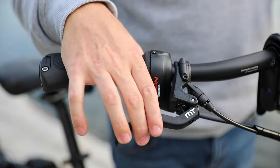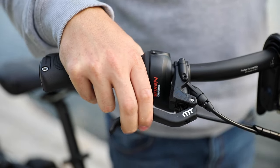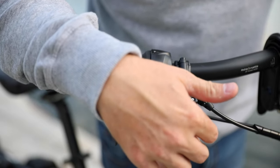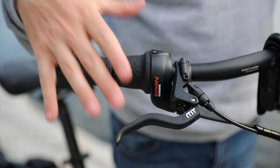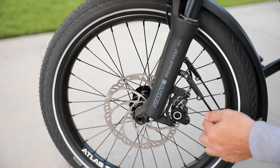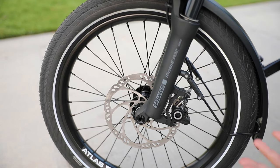For the brake levers, they're Magura MT4 two-finger levers with really nice ergonomics, and they're adjustable to fit any rider. If you have smaller hands there's a little screw you can adjust to pull the levers closer, or further out for larger hands. The P9 and S8i both have Magura MT4 brakes with a dual-piston caliper and 180-millimeter rotors front and rear, providing really good stopping power — plenty for this bike, especially with that extra weight capacity.